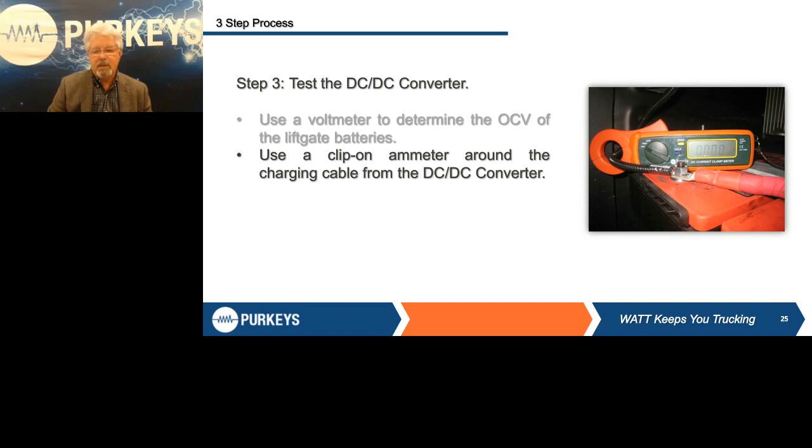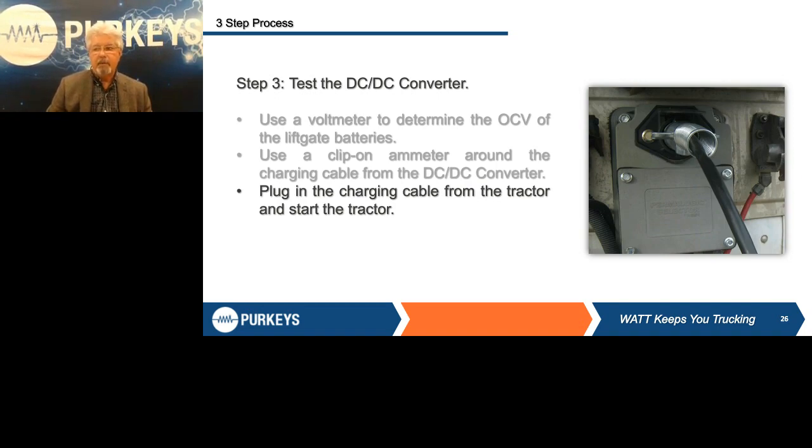In this case, on this DC DC converter, it has a green light on it. The green light should be solid if you're looking inside of the unit. The reason for the DC DC converter is that in cold weather, as I said earlier, you have to have higher voltage to be able to charge cold batteries. This DC DC converter has a temp comp inside of it — it's backed by the battery. So if it's at zero or minus 10 degrees, it automatically raises that voltage. Even if the input is maybe 9 volts by the time it gets back to the DC DC converter, it might have to go to 15.5 volts in order to push current through those batteries.